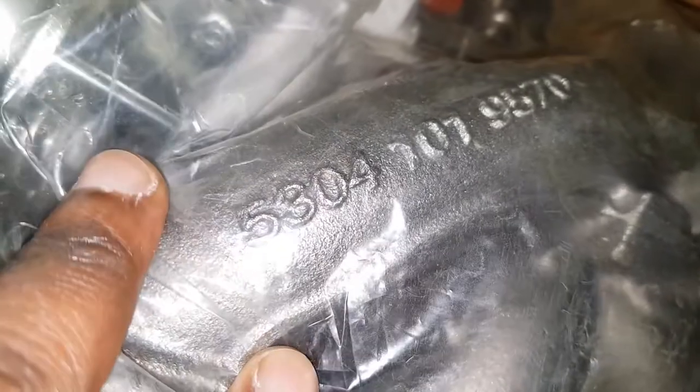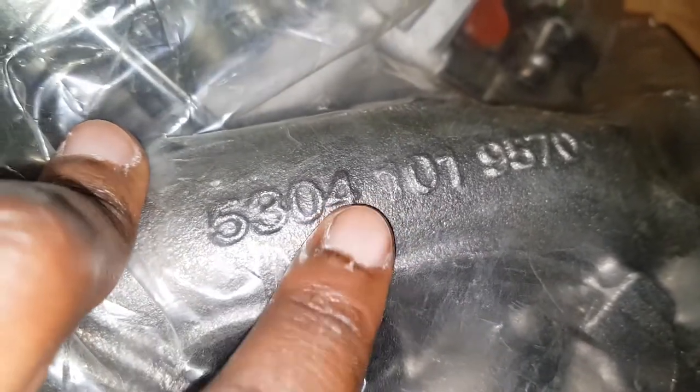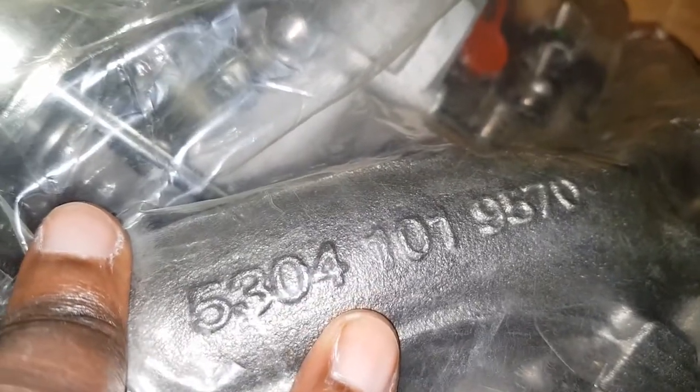And this is the big stuff. Itself. Oh, manifold. Sorry, kind of difficult to do this with one hand. But as you can see, official BorgWarner part number. Although it's not exactly a BorgWarner part, missing the K up front, but no worries, it's been copied very well. 5303 is a K03, the K03 has a 5303, so yeah, you know this is a K04.